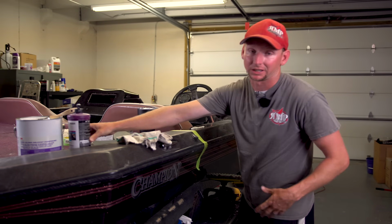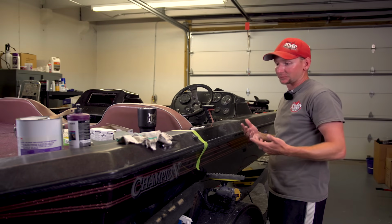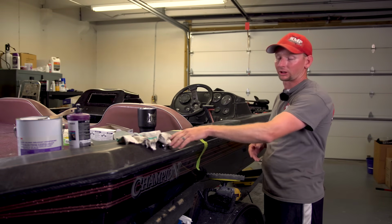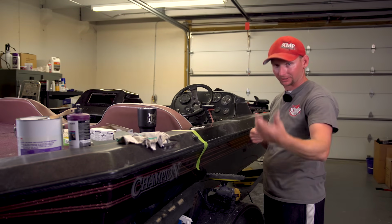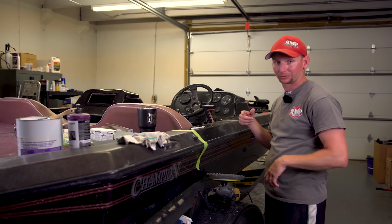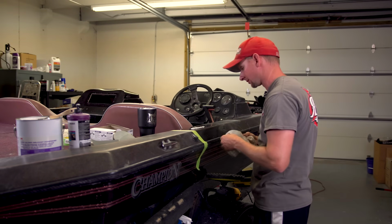One thing you will want to be careful of, especially when you're buffing, watch cords or cleats. We'll actually take this off when we finish the rest of the boat. That can grab the buffer and it'll yank some stuff, or it'll grab a cable, throw it around. It actually hurts. It's kind of funny to watch unless you're the guy that it happens to.